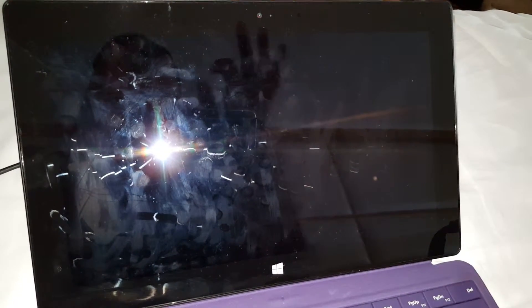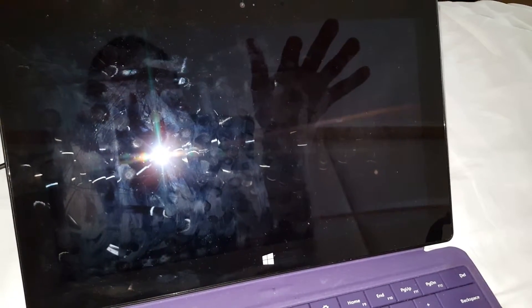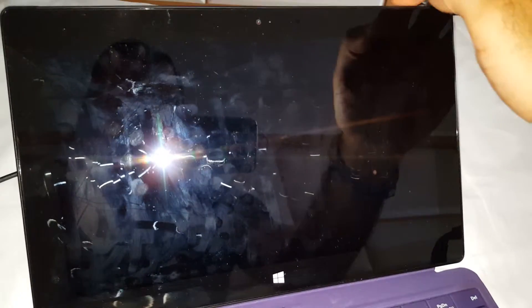The Surface wording will then disappear again, so wait the 15 seconds minimum — you can do 20, 25, or 30 seconds if you prefer to be safe. Then let go simultaneously. The screen will still be blank; wait another 15 seconds doing nothing, so it'll be switched off. Again, it can be more than 15 seconds, but minimum 15.